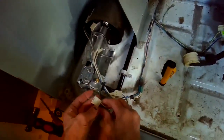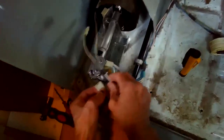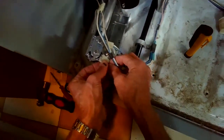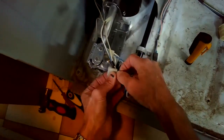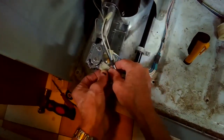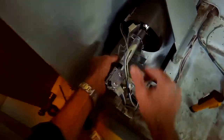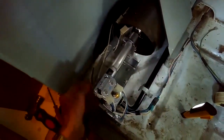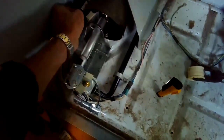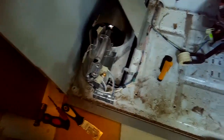We'll do the wire connections, a modular, hook up the primary and secondary gas valves. Really easy to do. Just line them up. Wiggle them in. Then there's a modular connector for the igniter. I'm going to pull this whole thing out of the way so that it's not near any of the heat. And that's pretty much done in the front.